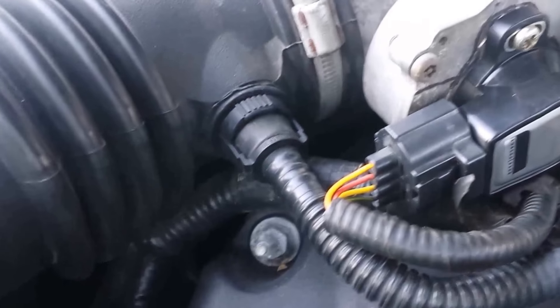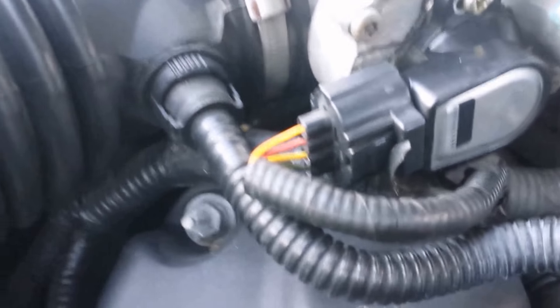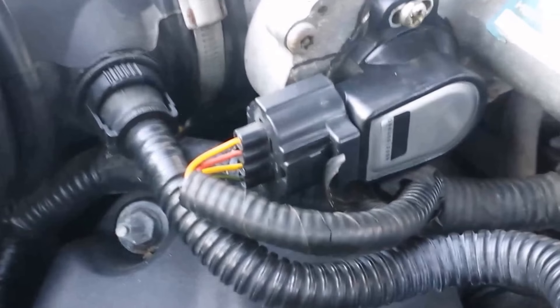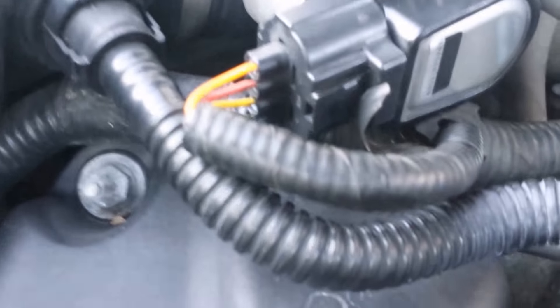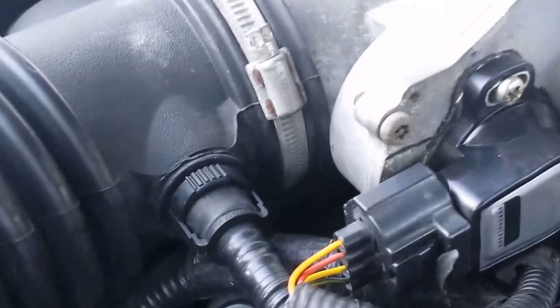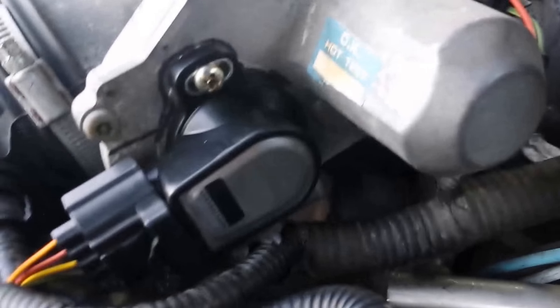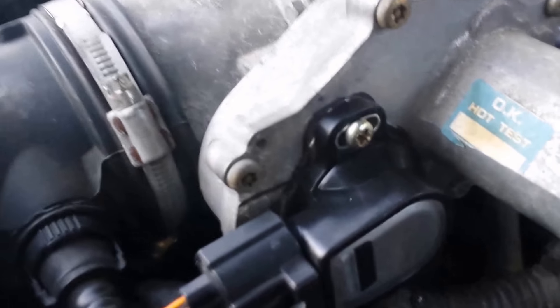I had to go and disconnect the negative terminal of the battery for a little over 12 hours — I did it overnight. It seems like the replacement throttle position sensor is working for me. The first time I put it in, the car just totally crapped out on me — it did not want to move. I got the code immediately. I put the old one back on and surprisingly it worked — I guess it was just programmed for it. I reset the whole thing, and my Sharpie markings definitely helped me keep the sensor aligned properly with respect to the throttle body.